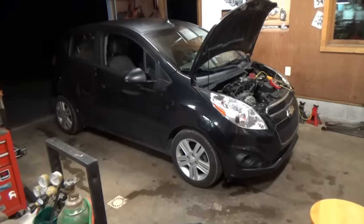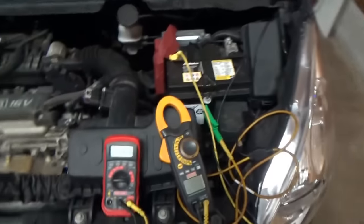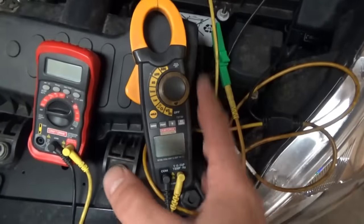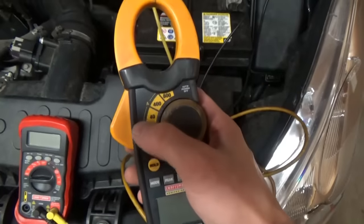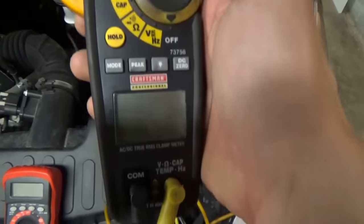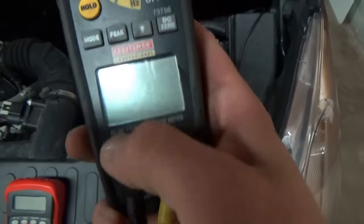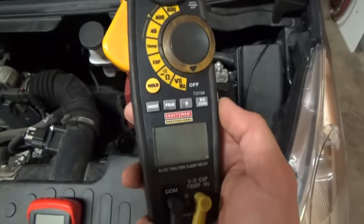Let's review the tools we'll need and basically go through the process. It should take about five minutes to check the whole charging system and be 100% accurate. My favorite tool for charging system diagnostics is my amp clamp. You need a DC setting so that it can measure current — in the amp setting you can measure 40, 400, or 800 amps. You want that to say DC. They sell clamps that only measure AC; that's not what you need for a car 12-volt system. You want the DC.